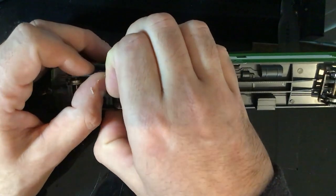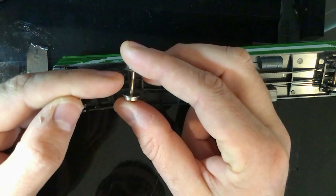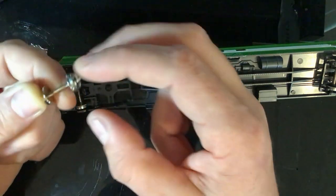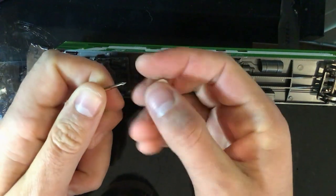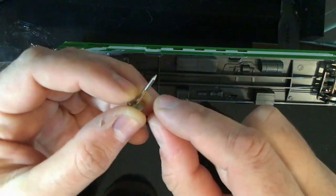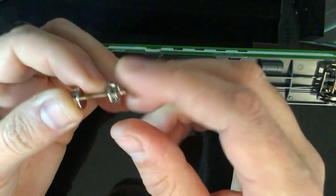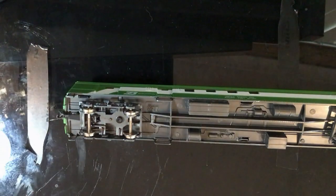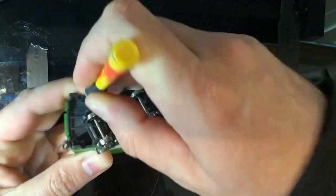To show you how you install these - the wheel pops out and it's got a plastic insert in the center, so you've got to get rid of the plastic ones and upgrade to these. All I did was pull one side of the wheel off, slip this little pickup in, then gauge your wheels again. Wheel gauged and it's back in place.